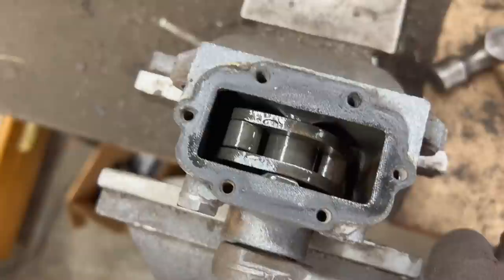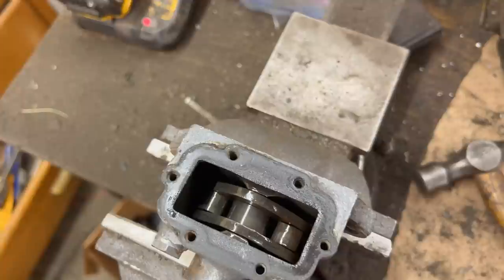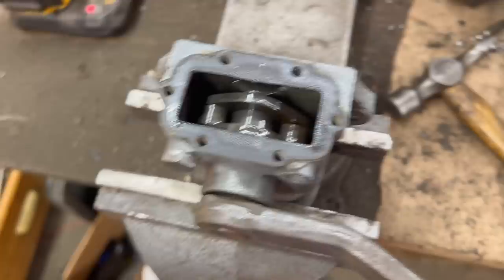So to empty the oil out, just basically turn it upside down, pump the arm a few times. That'll basically clean most of the oil out. I do actually have a video on my channel. Maybe I'll post a link up in the corner if you're interested in doing a little bit more than just changing the oil out in these shocks. Generally, you can clean them out as well. You just give them a quick shot of mineral oil, rinse that through, blow them out.